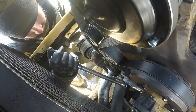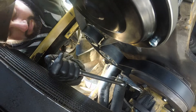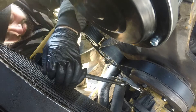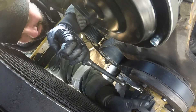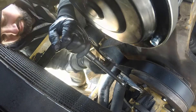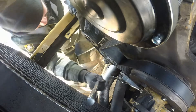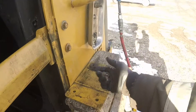Check that the belt is in the grooves and not twisted or crossed against the slots on the pulleys. Before you release the tensioner, make sure everything is intact and the belt isn't half-engaged on the grooves or going to cut across. It's actually pretty easy because there's tons of room.